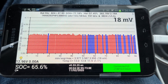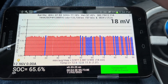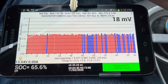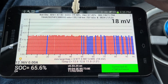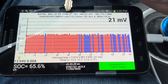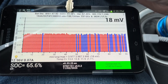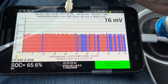A lot of us probably originally hooked up LeafSpy because you wanted to find out the health of the battery, and that's this measurement right here — that's the state of health. That is 77% on this particular car, meaning it still maintains 77.18% of its original capacity. In other words, if you had a range of 100 miles or 100 kilometers, the range now is only 77 miles or kilometers. It's fairly well understood, but it's also a very important one.